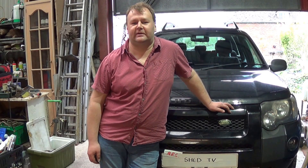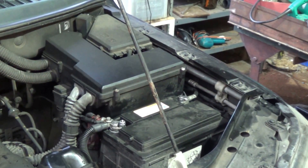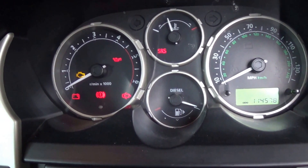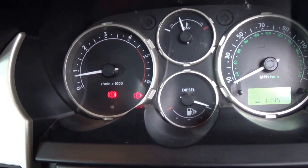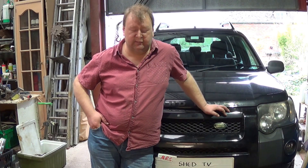My wife's car has been a bit problematic recently. It's been quite difficult to start, sluggish on the starter motor, and on a couple of occasions I've had to get the jump leads out and start it that way. I suspect the battery is knackered because it looks like the original one. The battery light comes on as you'd expect and then goes out again, which indicates the alternator is charging it. If you drive around for an hour or so it takes some charge, but then overnight it seems to die off. All of these things point to it being the battery, but it's worth doing a couple of checks to make sure it's not another component before buying an expensive new battery.